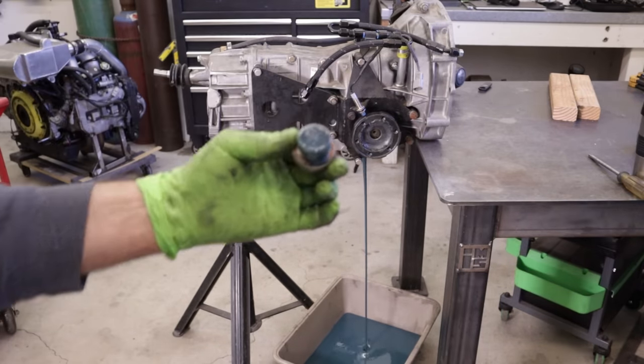I see broken pieces. I'm no expert, but this could be a clue. The actual synchro ring itself looks just fine. This is an exploded view of the broken part. My guess is it broke like this: the shockproof oil slows down synchro engagement, I got impatient and forced it into fifth, and the force of jamming it into fifth broke the part. Let me know if you have another hypothesis. The broken piece is called a lever box. The parts have been ordered and the car should be back together in a week to ten days.